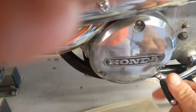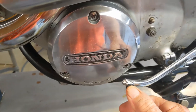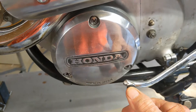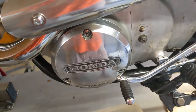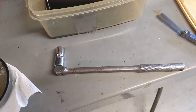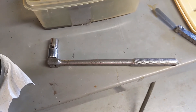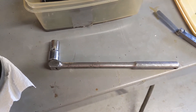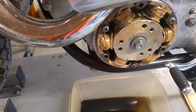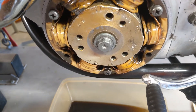One note is that you do have to push down on the gear change mechanism here in order to get to this lower right-hand screw. The next thing you need is a 14 millimeter socket, and it's best to have it on a long bar, so I used an adapter to go up in size.